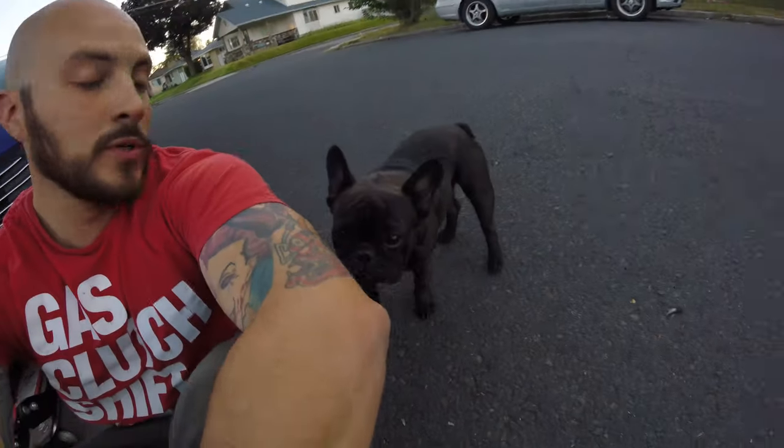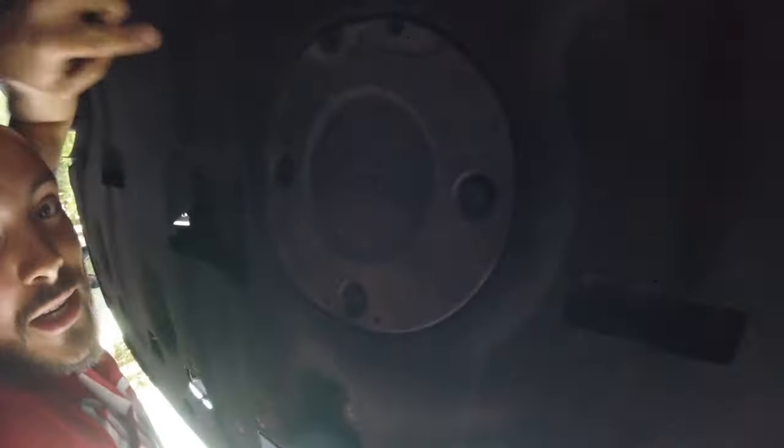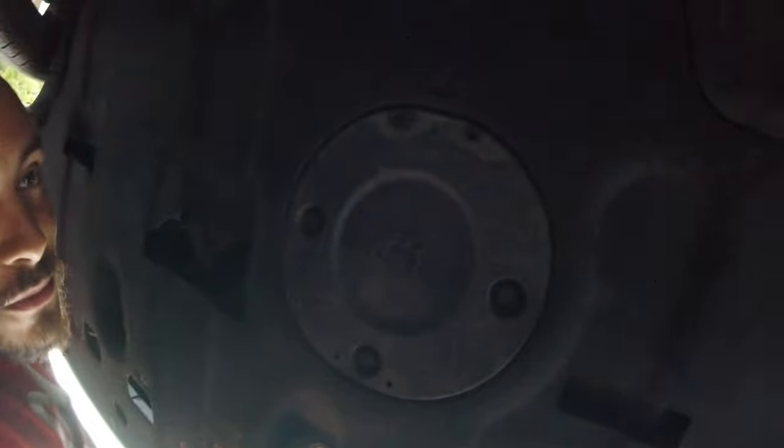Now I have to change the oil on my daily. If you guys are interested, keep watching - it's a 2019 Hyundai Ioniq. It's actually quite convenient to do the oil change on. I'm just going to find a good jack spot. My favorite thing about this car is it's got this tray - everyone hates these trays. But it actually even labels it: 'Oil Filter Cap' - just three 10mm bolts - and 'Engine Oil' - just two 10mm bolts. Very easy to take off.